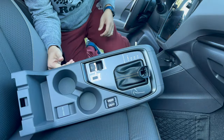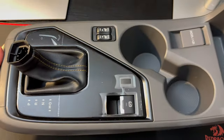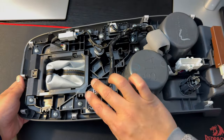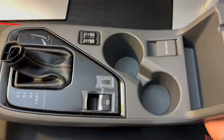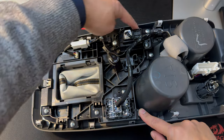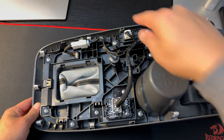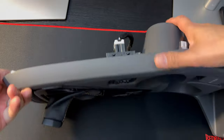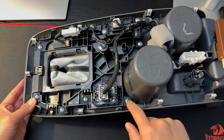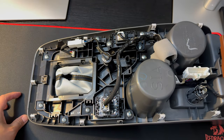That piece is now out — this is the piece I want. So now we're looking inside. This is what the bottom looks like and this is what the top looks like. This is going to be for your parking brake, this is for the illumination for the gear selection, and this is going to be your heated seats. Really all I want is this black plastic piece. So what that means is I've got to unscrew all of these screws and that black plastic piece should come out. That also means I'm going to have to remove all of this wiring to get that piece out.